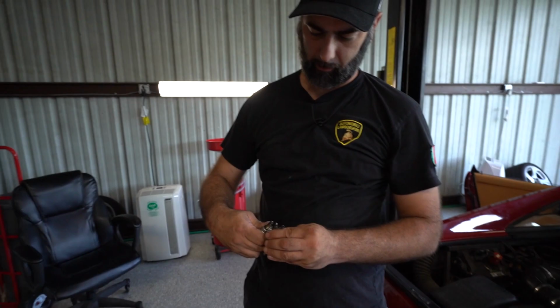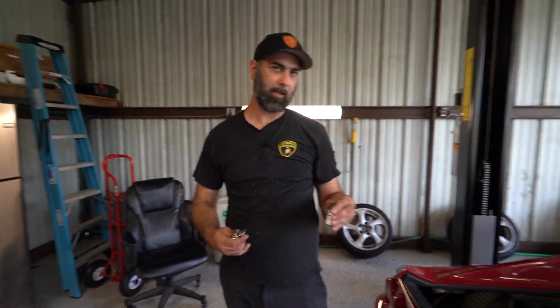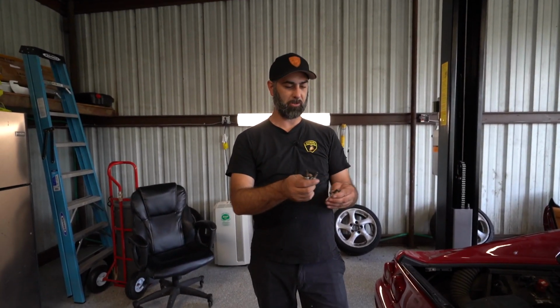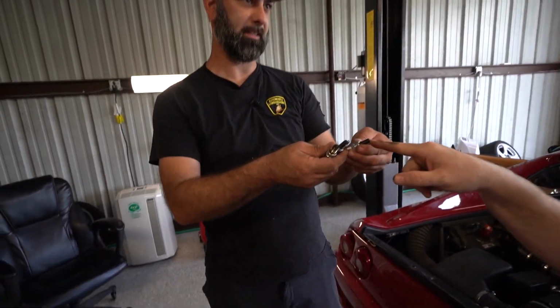So one of the things to realize about smell and engine performance: when you say it smells rich, you're not technically wrong, but it's incomplete. If we put a lambda probe on it, it's going to read lean, even though we're smelling the raw fuel, because there's incomplete combustion due to misfires. So you're getting raw fuel rolling out the tailpipe unburned.